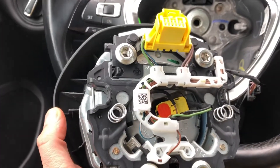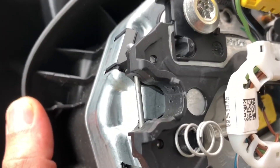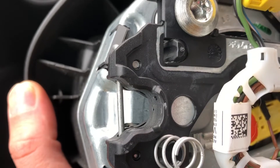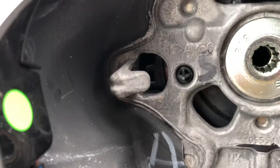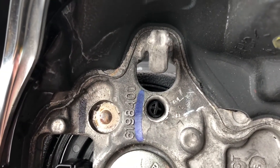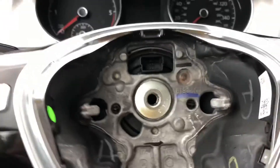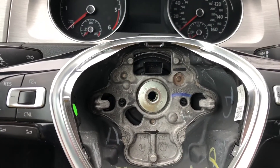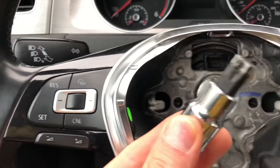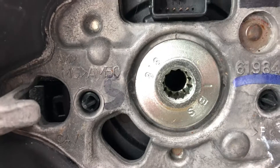I've removed the airbag from the back side of the steering wheel. This is the small spring clip you're trying to remove — these little clip spring barbs hook onto those hooks back there. When the wheel is turned you'll be able to remove the spring with a screwdriver. It's kind of difficult to portray through a video, but in person it's not so bad. We're going to make sure the wheel is completely centered before disassembling anything. I've chosen a T55 Torx nut driver that fits well enough — it's not the exact part, but it's close enough.